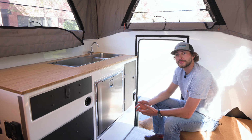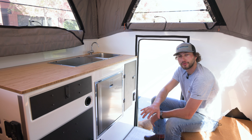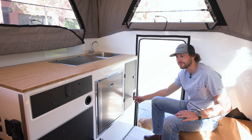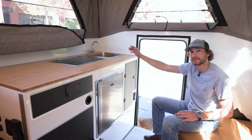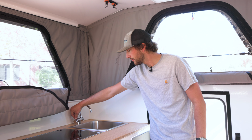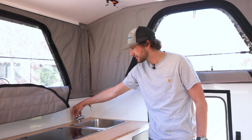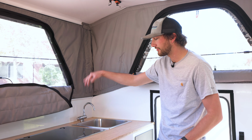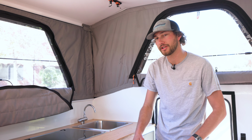So when that water stops draining out of your truck bed, you know that your freshwater tank's totally drained. We can go ahead and turn the water pump back off again, and we're going to move up to the sink and start draining the sink and the shower lines. We're going to cycle back and forth between cold and hot, kind of leave it somewhere in the middle, and you might hear some gurgling as that water leaves this and flows down through that winterizing drain.